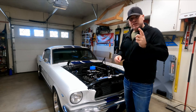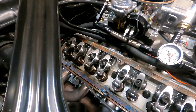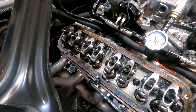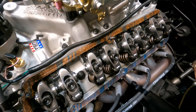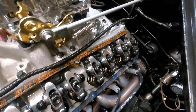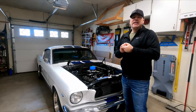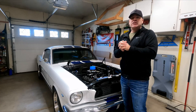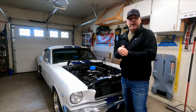What's up guys, my name is Andy. In this video I want to go in and readjust the valve lash on my motor. What I've got is a later model 302 that we punched out to a 347. I've got hydraulic rollers in here so I can fairly easily go in and adjust the valve lash on my setup. The reason why is I've developed a little bit of a ticking sound — the stereotypical sewing machine ticking that you can hear when the car is idling or even when you're driving.